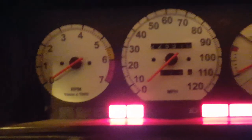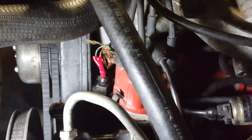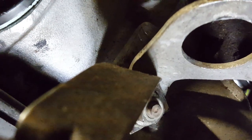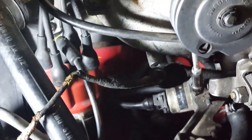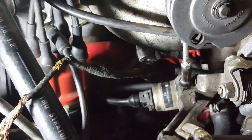Hopefully this doesn't — nope. We're not getting 12 volts to the red wire there, but you can tell it's totally junky in there because as you wiggle this connector with the ignition on, there it's making spark. That's that ticking you're hearing and the whining of the fuel pumps — I think it's constantly firing the fuel injectors. You follow that up further and eventually you get to another break in the wire; that's where the red wire is disconnected, so it's possibly getting an inconsistent 12 volts. The wires are temporarily fixed until we can get a new connector.